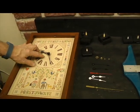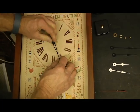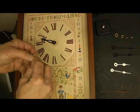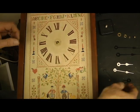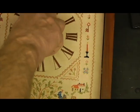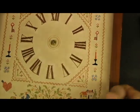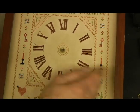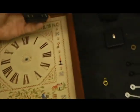The first thing to do is to remove the hands. We're going to take off the nut holding the minute hand on. Then we're going to take off the hour hand — the hour hand always just presses on, so just pull it straight off. Then there's a small nut holding the movement in place, so I'm going to unscrew that nut. Sometimes you have to use pliers to loosen it up a little bit, but this one is easy. There's also a small washer there that protects the face from that nut. And there's the old movement.